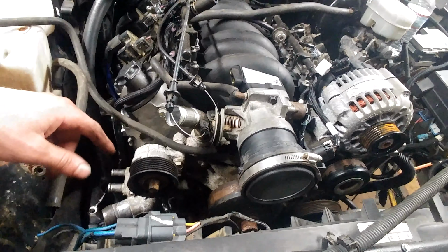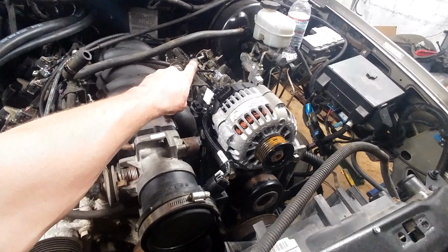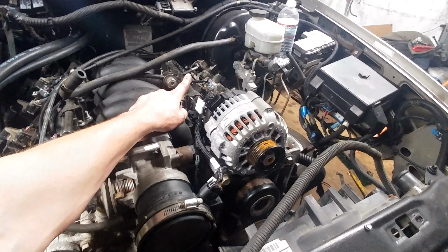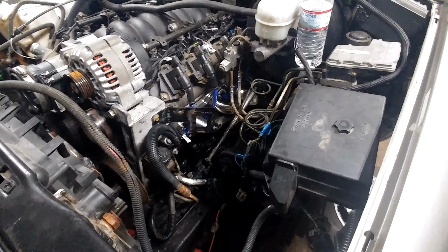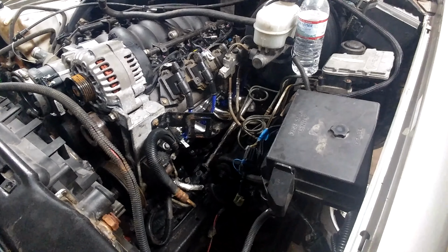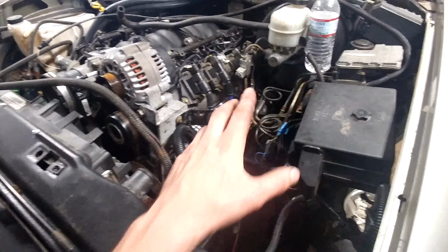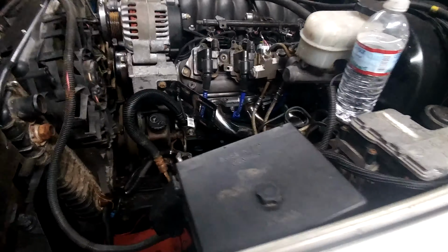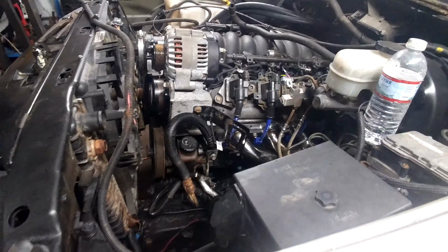The belt will be in tomorrow, along with the adapter to make the fuel rail dash six AN line. The steering is there. It clicks and clunks a little bit off the header. Definitely have to revisit this and do 2.0 after Wolfsgart. But for now, this will at least let the vehicle turn, and it just makes some funky noises when you're turning, like a really bad intermediate steering shaft clunk. But it's tight, it's strong, and it turns, so that's good.